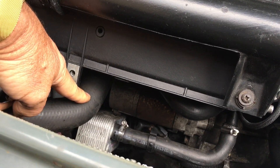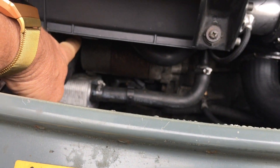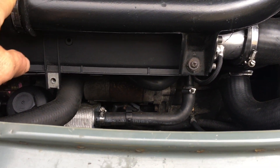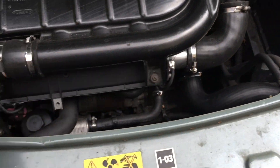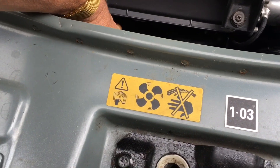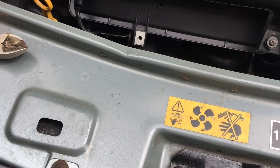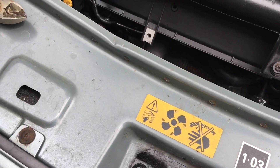Instead, there's a little thermostat in the outlet pipe of the engine over here — you can just about see down there where it joins onto the engine. To get a bit better access you could remove this inlet manifold part with a couple of screws, and remove some of these pipe fittings. That's not too difficult and gives you a bit more visibility. What we need is a little Dremel with a cutting disc on it to cut through the clamp that's on the pipe.